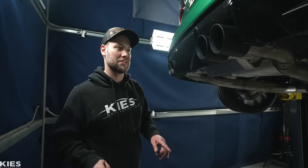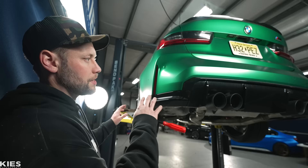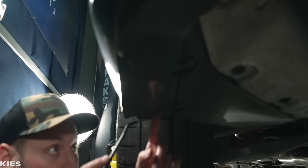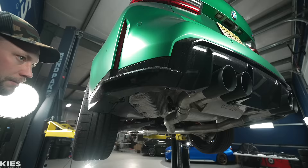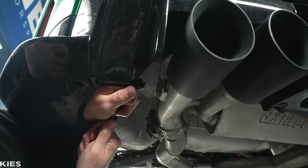We're going to take off this side and then pull the diffuser off. You're going to need a little trim popper tool like this. If you guys don't know what tools to get, we're going to have everything linked in the description below. If you take a look under here, you've got a little plastic fastener. This car has about 3,000 miles on it and these aren't aging all that well — I can't imagine getting these guys off when they have like 40,000 miles on it. While we're at it and I've already got the tool out, let's just take them all off because we're going to need to anyway.